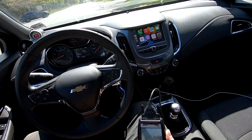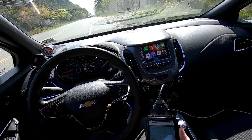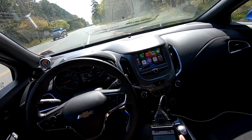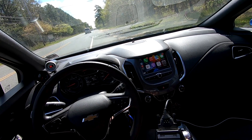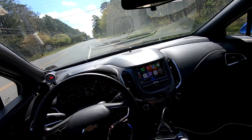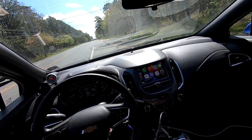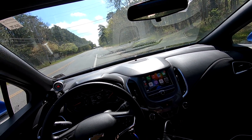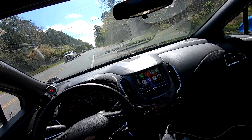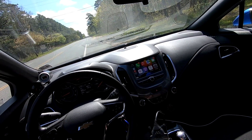Right now after driving, it's 75 degrees out and the intake temperature is at 81 degrees. 81 degrees is perfectly fine — that's exactly what we want to see. The factory intercooler at this point would probably be 100 degrees or more. Keep in mind my car is a big turbo, so my intake temperatures are going to be hotter than what a regular intercooler would see. The average person who runs a factory intercooler, once you start getting heat soak, it's around 175 degrees with a big turbo. I'll just cut over to when this thing gets hot enough.